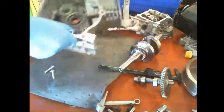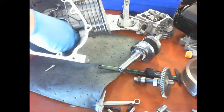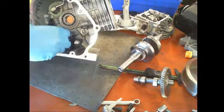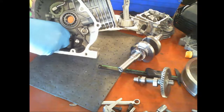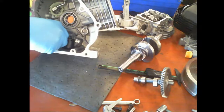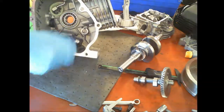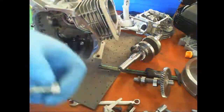Now, is that the wrench I would use, 6mm? No, it won't. It'll be an 8mm wrench. Eight millimeter wrench, but it's a 6mm bolt, because when we measure bolts, we measure them at the thread or shank, not the bolt head.